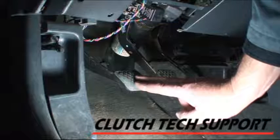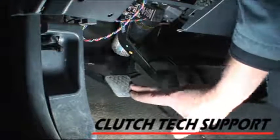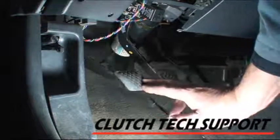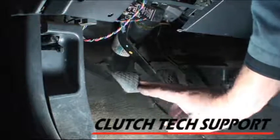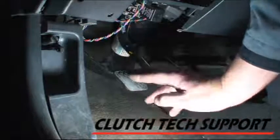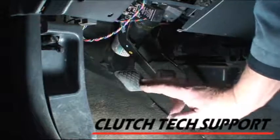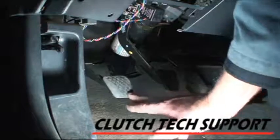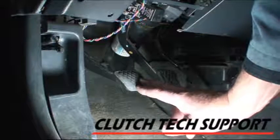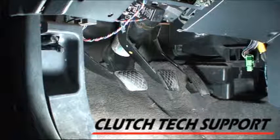I'm going to push the clutch pedal with my fingertips only. It actually goes pretty far with just my fingers. The clutch does release, but we don't have as much reserve travel — distance coming up off the floorboard before the clutch starts to drive the car. Let's take a look at this master cylinder, see if there's anything going on there, and we'll replace the master and slave cylinder and hopefully come up with the best procedure to bleed this Honda.